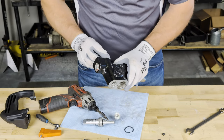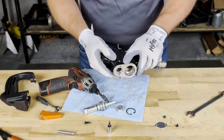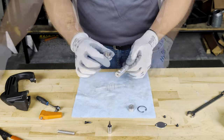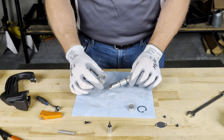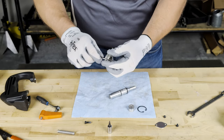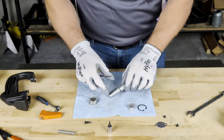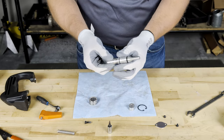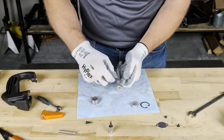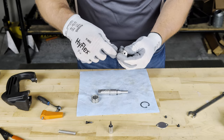The last component is to ensure the lower assembly is removed as well. At this point, we will no longer need the body assembly and we will be working purely on the internal components. The first thing we will do is remove the bushing ring that sits around the valve body. Utilizing your screwdriver or your pick tool, remove the gasket. Next, there are two gaskets around the valve itself. And lastly, the lower retaining assembly for the valve.